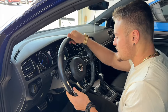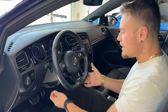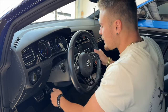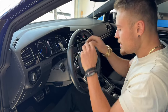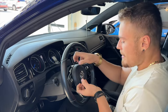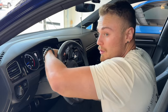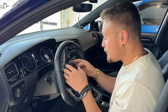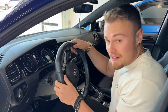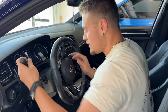The first step in removing the steering wheel and the airbag is to grab yourself a long flathead screwdriver or something similar. You want to pull the steering wheel out and down as far as you can, because what we're trying to do is access the back of the steering wheel. There are going to be two holes where we stick this through, where we can unlatch the airbag and actually pull it off the car. First thing we're going to do, turn the car on — you have to have the car on. In my last video, so many people were arguing that you have to turn the battery off before you start, which makes sense, but you can't physically turn the wheel without the car on. So leave the car on, unclip the airbag first, then we will turn the battery off.